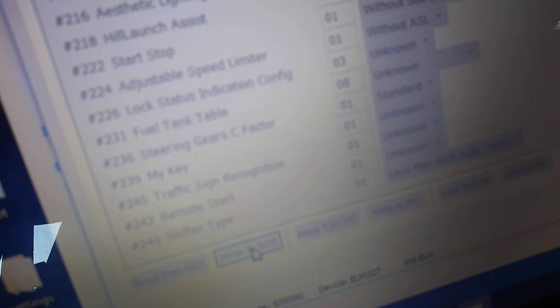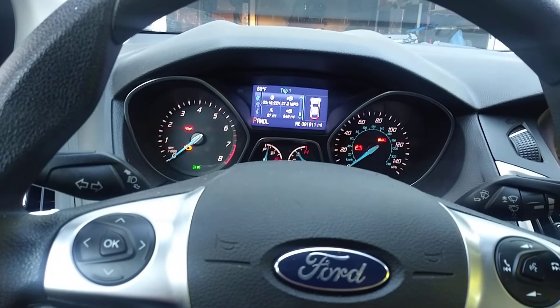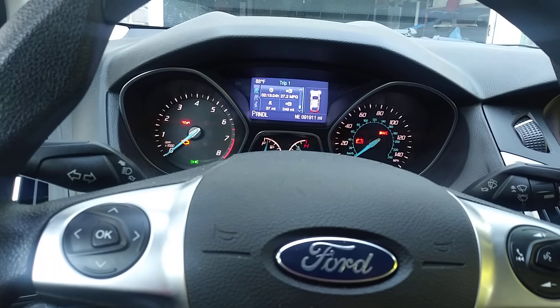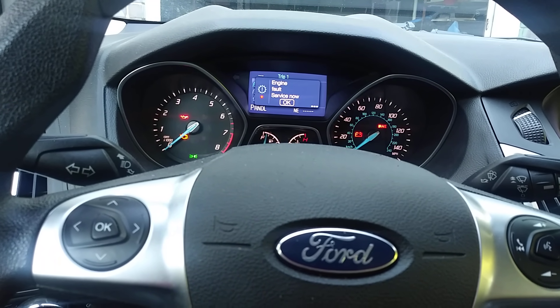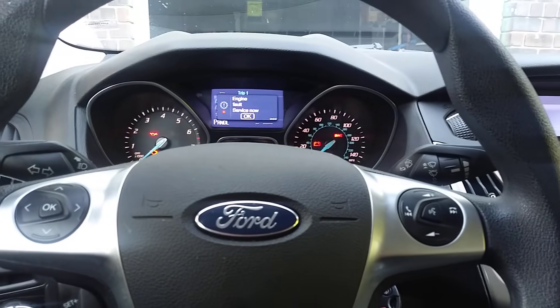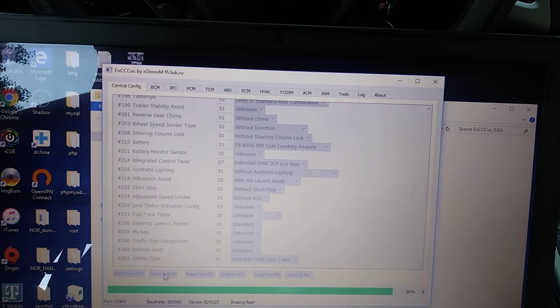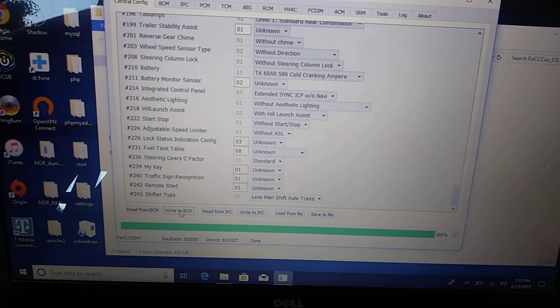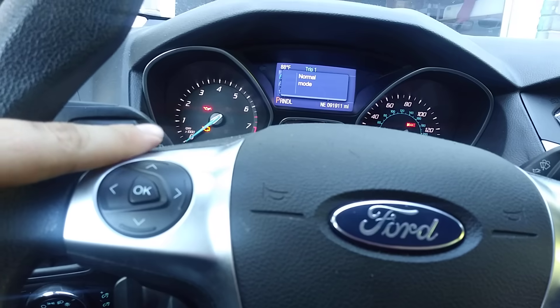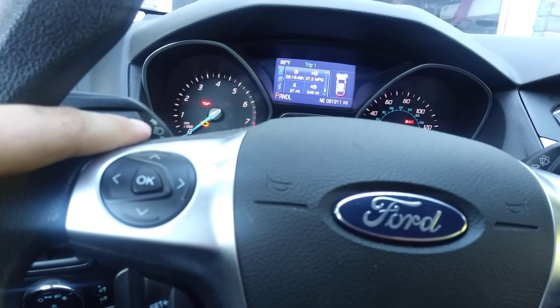You're going to write to the BCM and it's going to write. You're going to hear the engine cycle, and it's going to keep showing engine faults — that's because it cycles through everything and disconnects the connection. If this was successfully written without issues, your check engine light will go off. If it happens to fail at any point, your check engine light will be on when you start the vehicle.